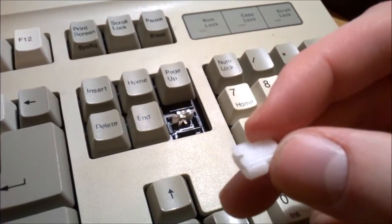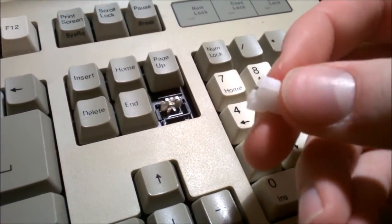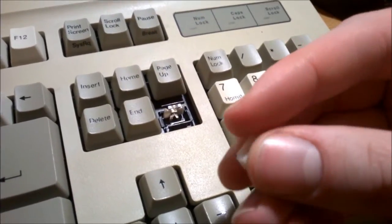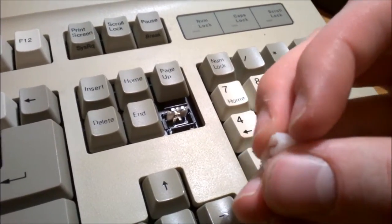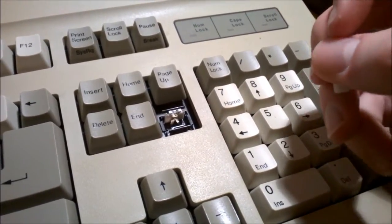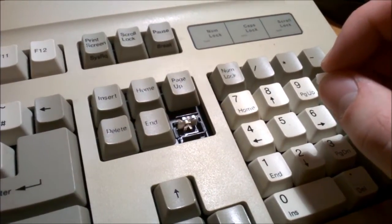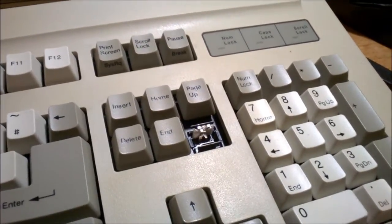Then look at the slider. The slider has one side with a little indent; the other side doesn't. You want the slider to be nice and smooth. If it's scratched or feels a bit strange, you might want to apply some lube to it. You can also use lube to quieten the switch a little bit. Just don't use any water-based ones, and preferably use ones that don't dry out quickly.